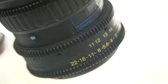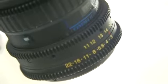Now I know that on the Tokina 11-16mm for the still camera, it's a 2.8 lens, but this one's marked with a 3. Can you explain that? Well, the reason it's marked with a 3 is because it's a T3. It's mathematically an f/2.8 lens, and if you measured the light it would be an f/2.8 — but it's actually a T3, which is how that all works out. T-stops are the cinema version.